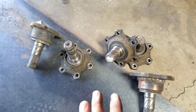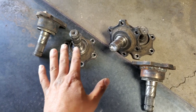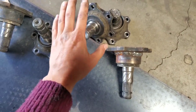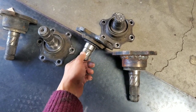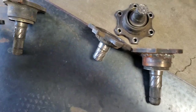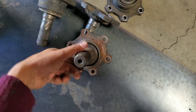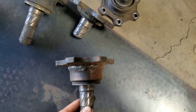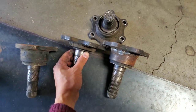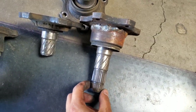Usually for the swap, what you need is a shorter axle, which is super hard to find. The only one available is the 300ZX twin turbo — everybody and their grandma's looking for it, so they're like 300 bucks an axle and super hard to find. So instead of finding the right axle or doing it the axle way, I ended up just cutting the flange to a different depth. That way I can get away with a $45 axle off the Q45 that nobody uses, versus running a very sought-after 300ZX axle.